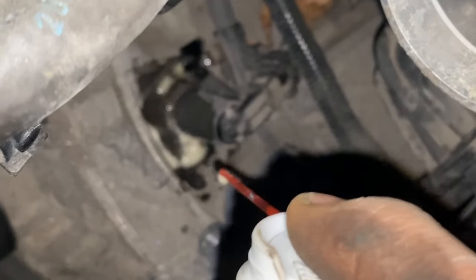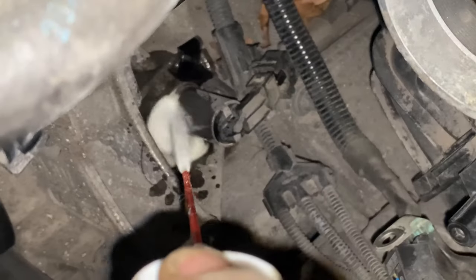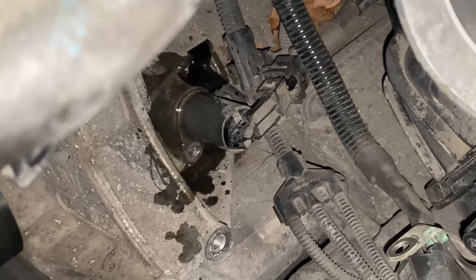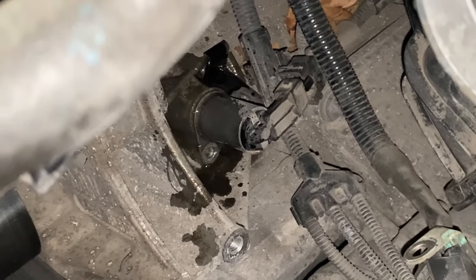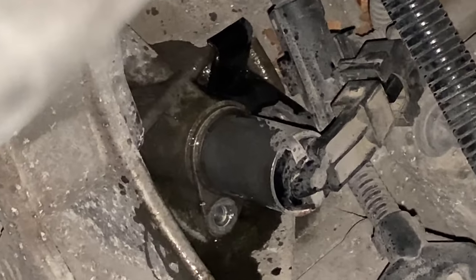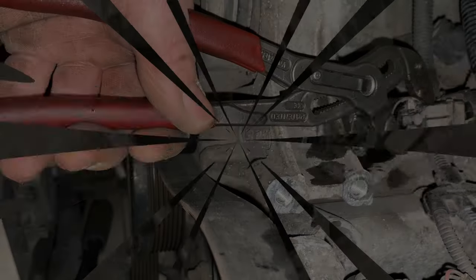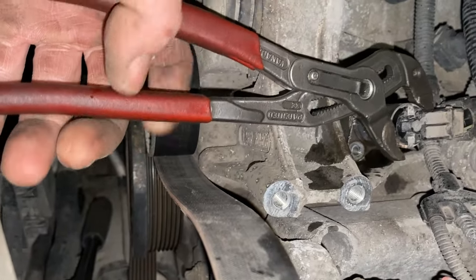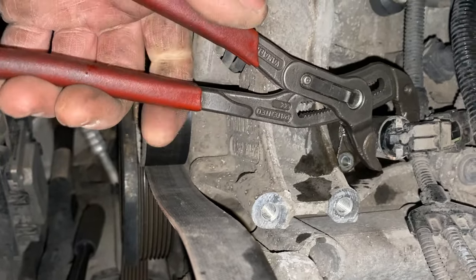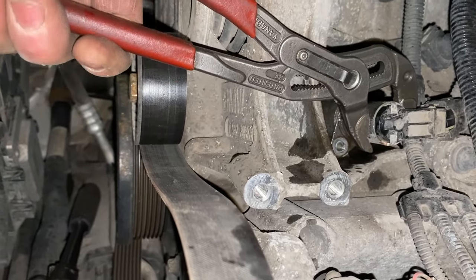It's a bit messy, and I really want to get it onto that bit of flange there. Very messy stuff. But my God, I've got things out that have been so tight that even the Nano we used didn't come anywhere near close. See it bubbling away there now. You get yourself a good pair of Knipex pliers like this, come right near the end where it's quite solid, and just give it a gentle turn. It really moves by such a small amount.